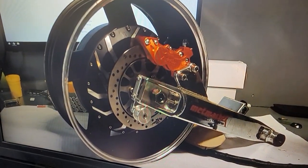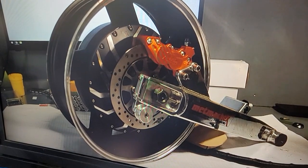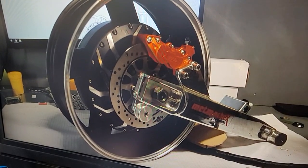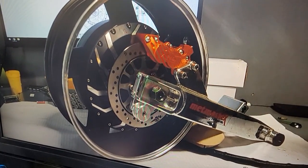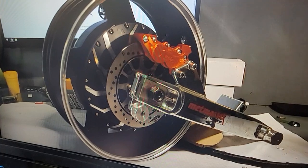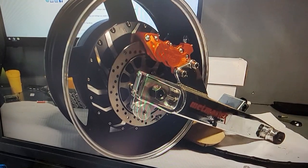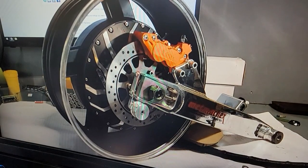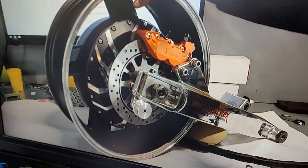The magnet height on this is 70mm, we've got 16 pairs of magnets, and the max speed is rated at 140 kilometers per hour. The required rear fork width is 230mm. There are two types of temperature sensors — the KTY83 and the 122 — and it's water resistant at IP54. Beyond that they're not telling you much else. It's an absolutely humongous motor — it weighs the world, the universe even.